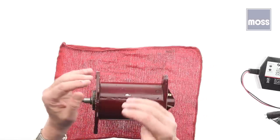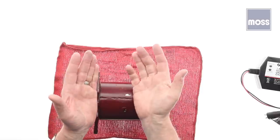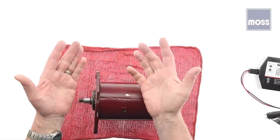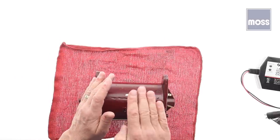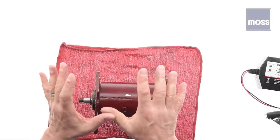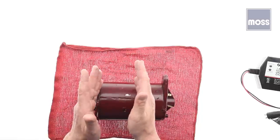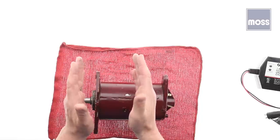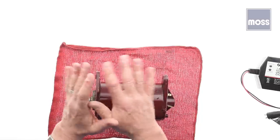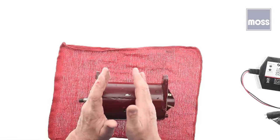The charging system was designed to recharge the battery after it lost a little power to start the car. After that, all the charging system was designed to do is produce enough current to run the lights and ignition system. It was designed to maintain the battery, not to resuscitate it. Completely recharging a badly discharged battery was not part of the plan — your generator or alternator was simply not built for that.